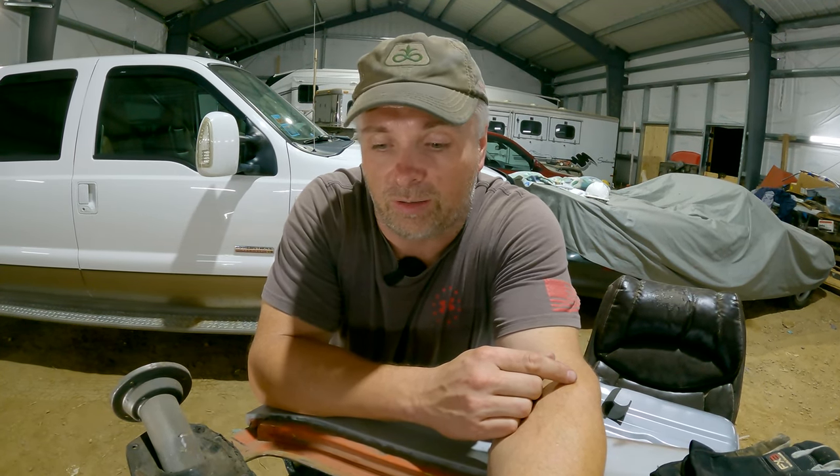We'll come back with a solution on how to get this tank strapped in and hung. Then we can put on our rubber fuel lines to our vent stack and get our new metal fuel line run. We probably should put it on since we have it — get it up to the fuel pump, up to the carburetor, and remove that one-gallon gas can from underneath the hood. Maybe our fuel sender even works. We'll come back after the rain and keep plugging forward.